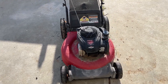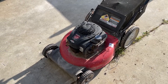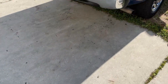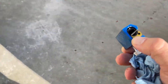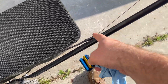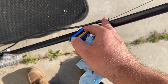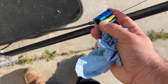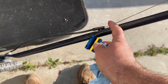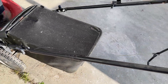So this is what we're going to be working on today — this Yard Machines 21-inch lawnmower with the newer Briggs & Stratton on it. The only thing I've done so far is use my little cable tool. I took the blade control cable off, slid this on, shot a bunch of WD-40 into here, and it cleared everything up — so now the cable's working and I don't have to replace it.